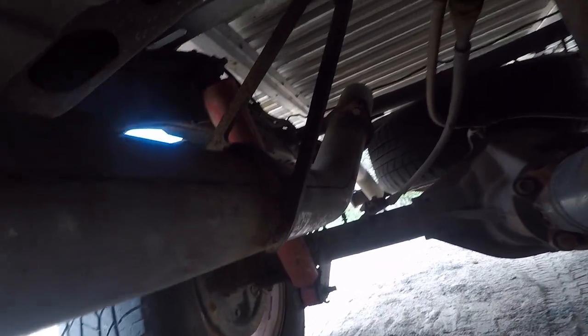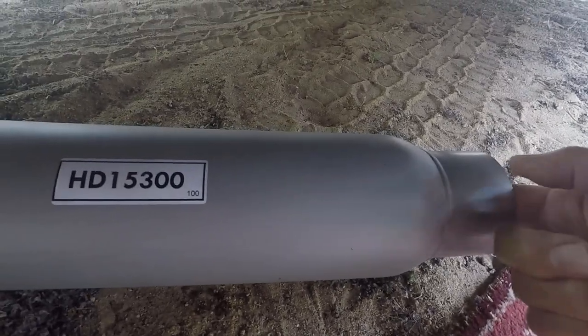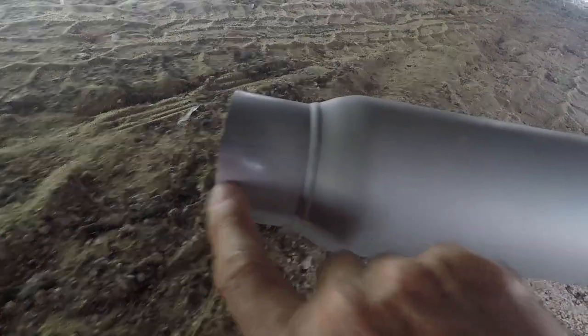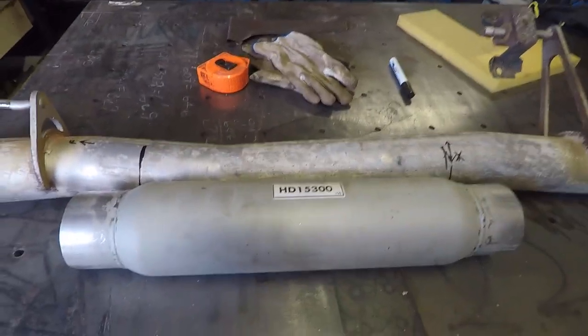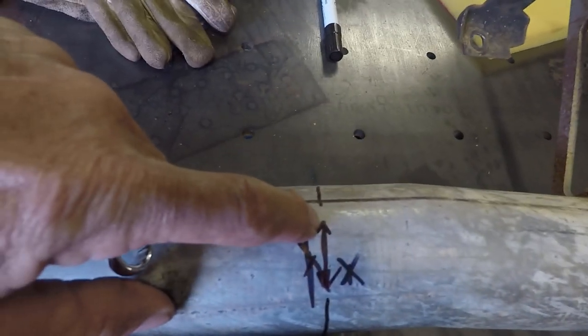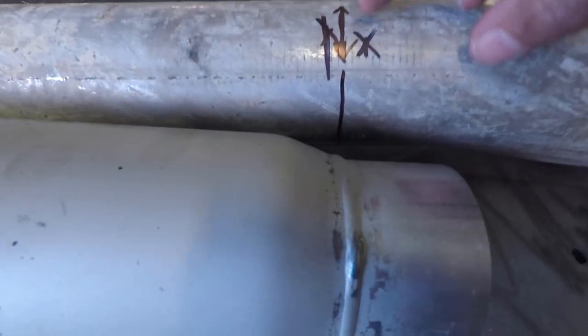What I'm going to do is drop the front flange and see if I can line the pipe up — we're going to have to weld it in. This muffler has got oversized ends: the inside is 77mm so the original 75mm pipe will fit inside. I'll measure from weld to weld, giving me an inch and a half overlap on the pipe. I've marked the pipe I've pulled out and referenced these welds, so now I've got to cut the pipe here and along there.